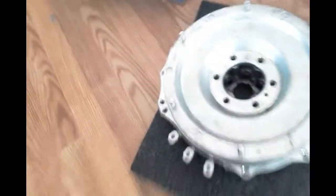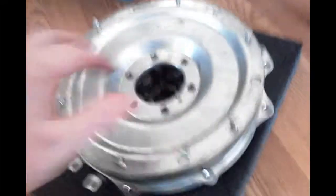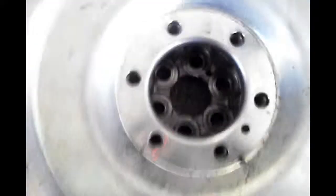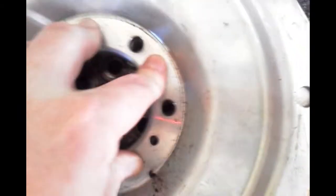Again this is crude plastic ruler eyeballing, but I'm seeing 65 millimeters of thickness on the 3rd Gen 17 kilowatt Civic IMA motor, and 70 millimeters on the 10 kilowatt Gen 1 Honda Insight IMA motor. Now this is really interesting and promising — the six flywheel points on this commutation disc from the Gen 1 Insight, sitting on top of the Civic IMA motor on the transmission side, show that the bolts actually line up, which is really interesting.